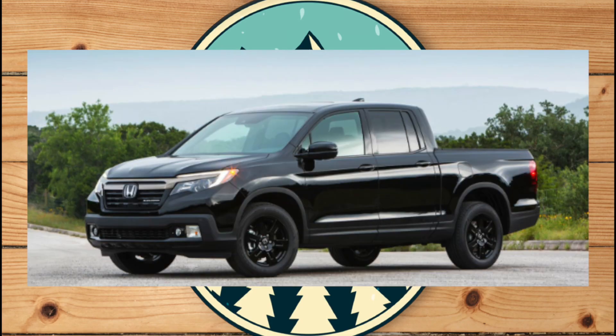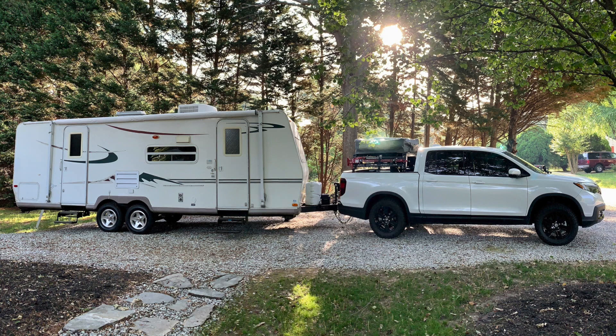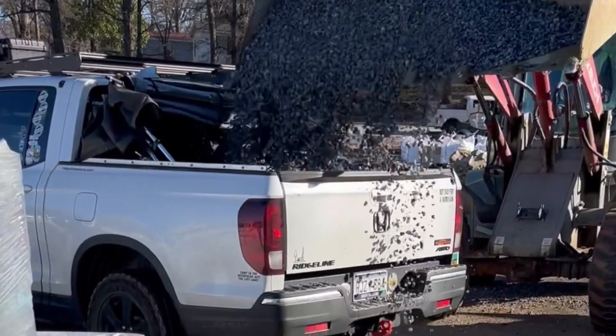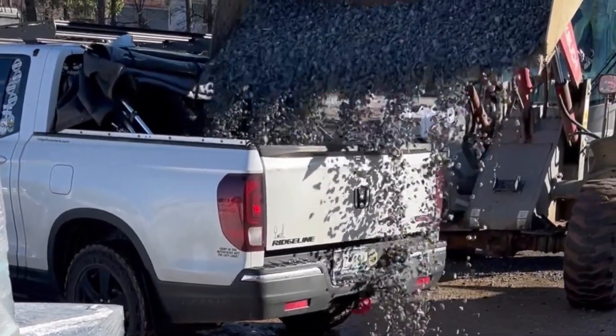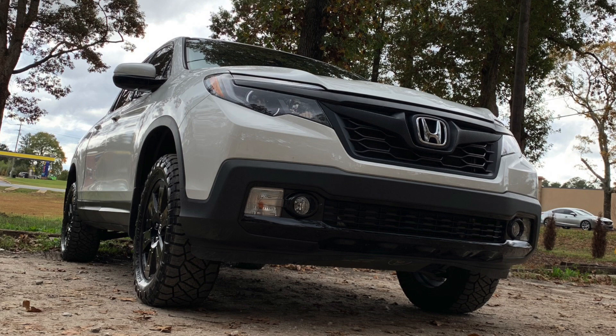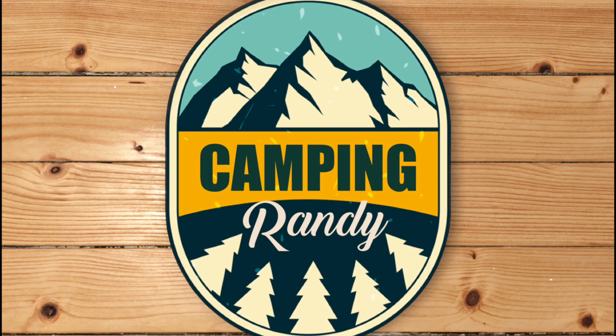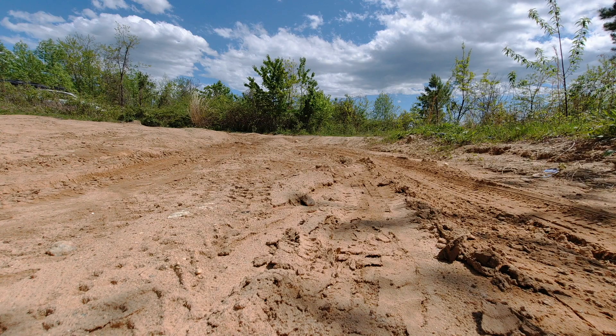If you want more of a level look than a rake - when I talk about rake, if you walk away from your Ridgeline you're going to see it looks like it's sitting at a 45-degree angle where the front is nose down and the rear is high up. The reason for this is so that when you tow or put 1,500 pounds of payload in the back, the car isn't sitting on bump stops. So you do one and a half in the front and one inch in the back for clearance throughout. If you're going to tow or have a bed rack or roof rack, then one and a half front and rear - when you load it down with a rooftop tent it's going to level the truck out.